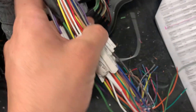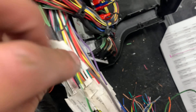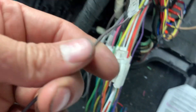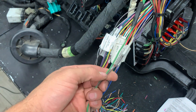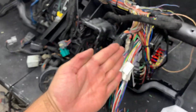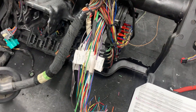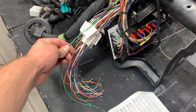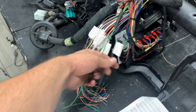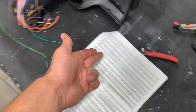Right there, you can see it — that's what that green one needs to go to. This is going to be what goes to the brake light. I'm probably just going to cut it, twist them together, and solder it. Make sure you solder it — if you use butt connectors on this, I'll be disappointed. No butt connectors — heat shrink and solder everything. Make sure you put heat shrink on first. I'm gonna take care of that oddball one first and then start shooting them down and do the wipers and everything else.